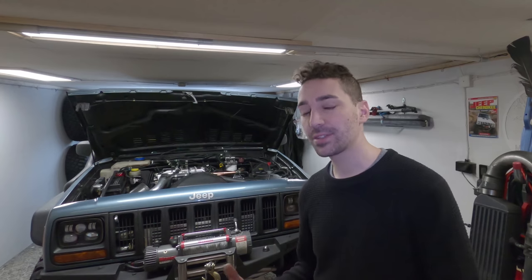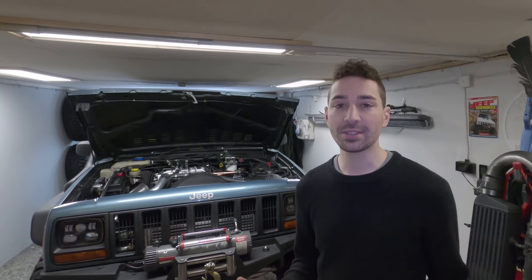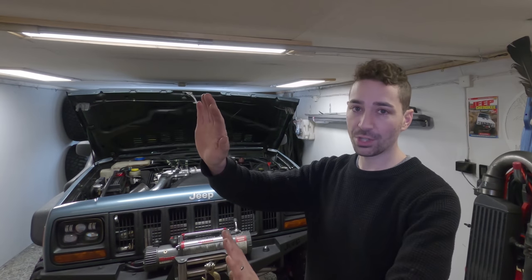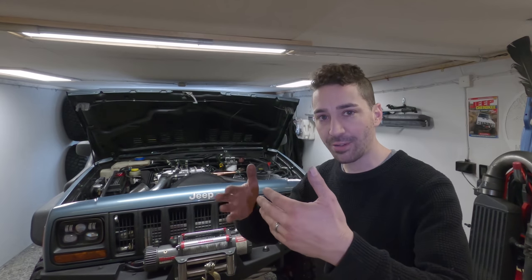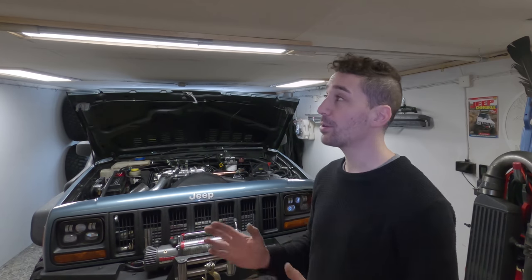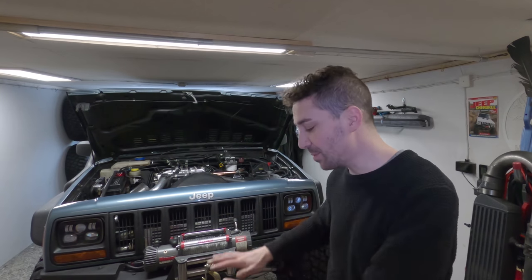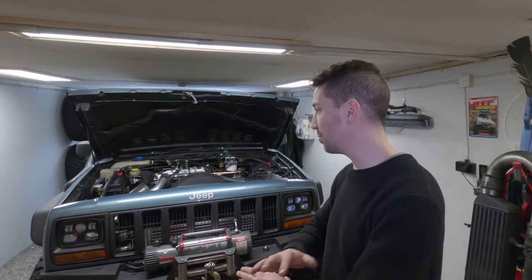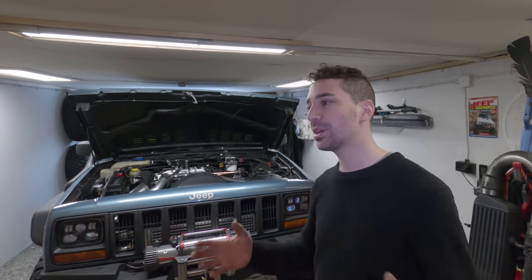If you're going to put a carpet back in the vehicle, you do not need to do what I've done. I've gone for pretty much full coverage, and even though I've named this video 'sound deadening,' Silent Coat is more of a vibration dampening product than a true sound deadening product. Really, all you need to do is take one or two sheets and put them on the inside of a door, for example - that will take the vibration out of that large flat piece of metal. You only really need some squares on the roof in various locations and a few on the floor pan.